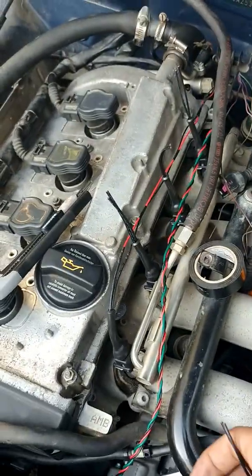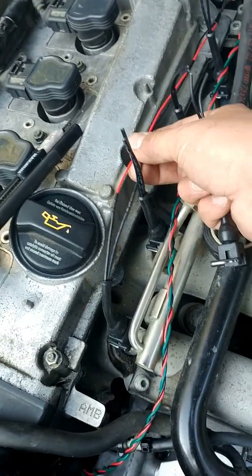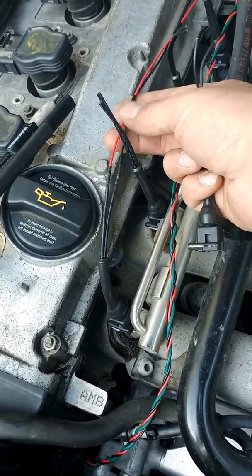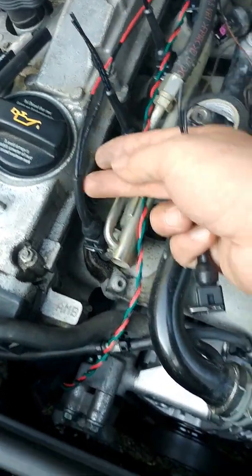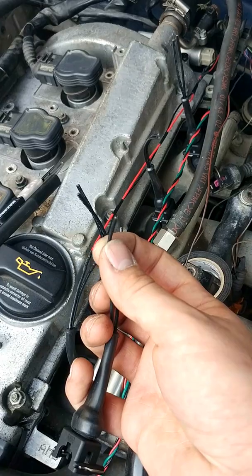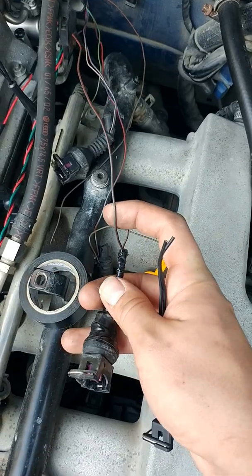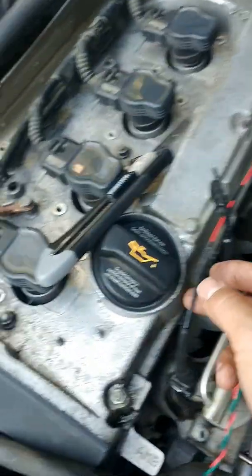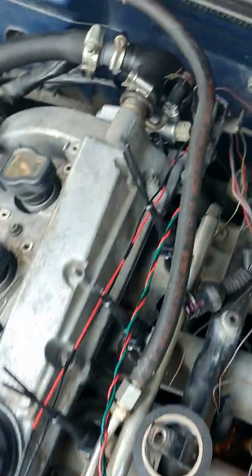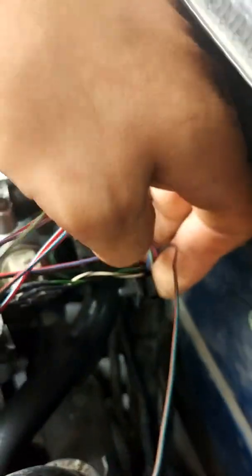So basically you just clip them on, splice them up, and put — I think it's a 22 gauge wire. The original size of the wire, because these pigtails are actually 18 gauge, but the original wires of your car are probably like a 20 or 22 gauge, so you can put an 18 or a 20 gauge — it'll still work. Then you just cut it not too far back, like here where the end of the wires goes into the loom.